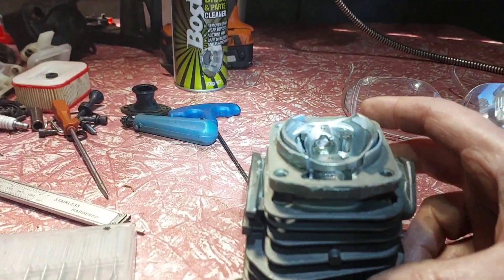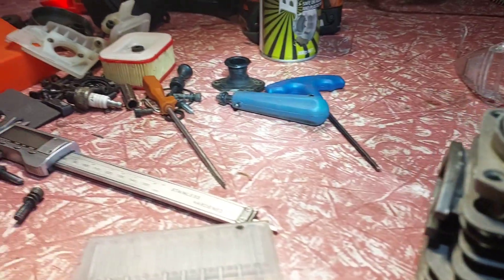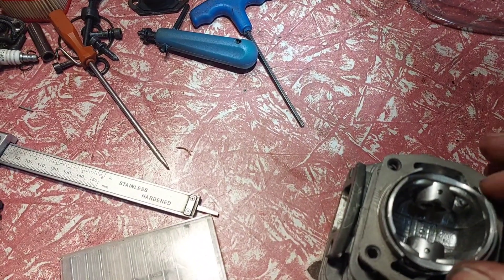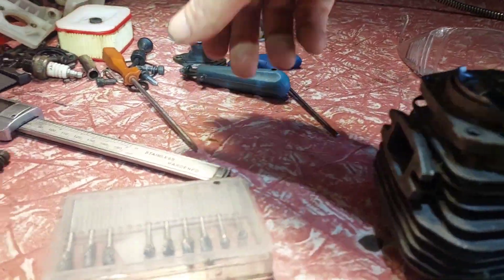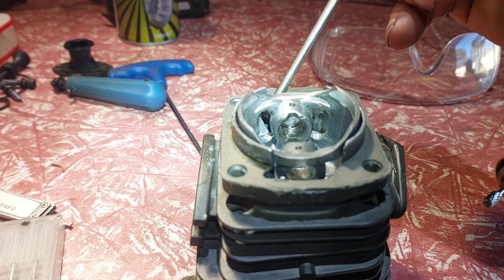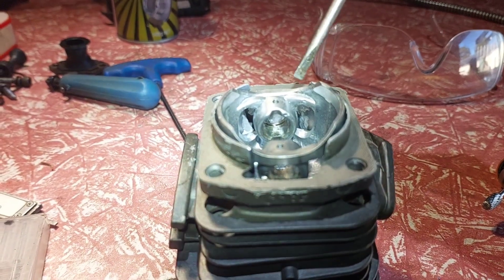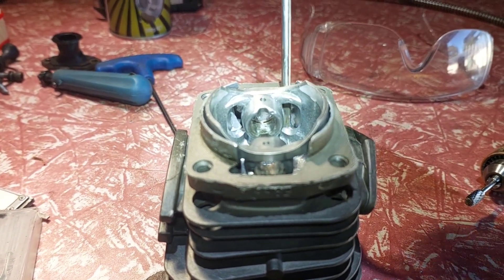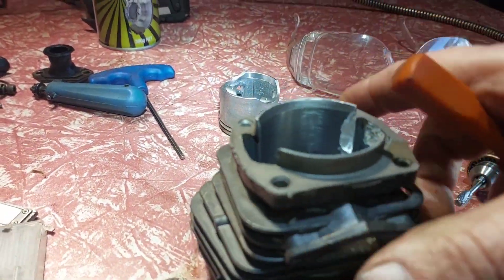This isn't finished but you'll get the idea. The piston is at bottom dead centre — I'll drop it in and look from above. The window that was covered before on the piston is now open — you can see the screwdriver from behind. We've now got airflow. This is as low as the piston will ever come in the cylinder. If you're doing this, make sure your rings always have something to seat on, otherwise you'll destroy your motor.